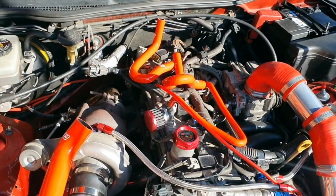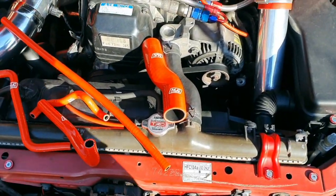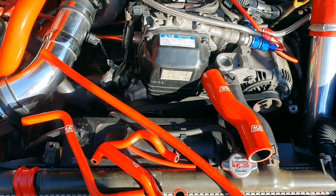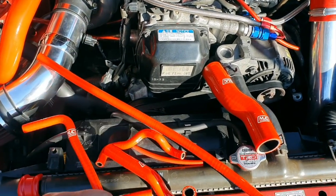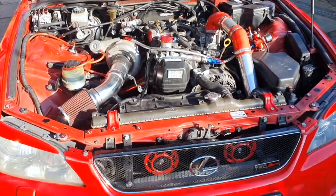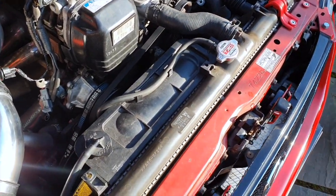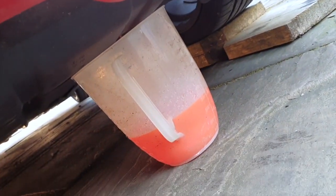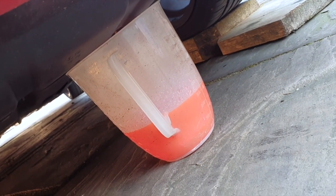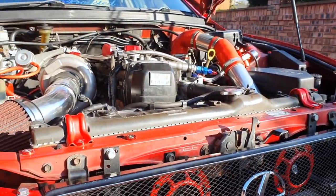It's fairly straightforward. The only major problem with doing this is that the engine's already got coolant going through it, so we'll have to either drain it or clamp off the hoses and replace them as quickly as possible. Currently I've got the coolant draining now — not too fast, just ever so slightly. I don't want to make a mess because I want to reuse that coolant, as it was recently flushed and refilled late last year. So we'll just wait for that and then start on the hoses.